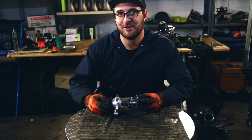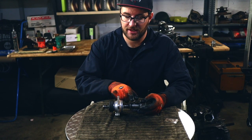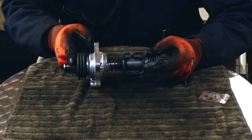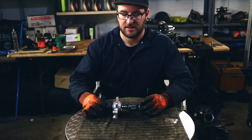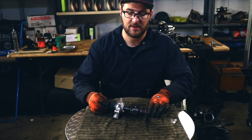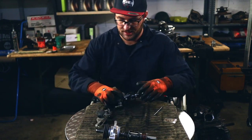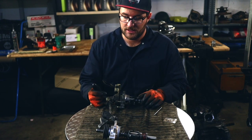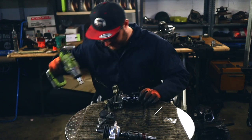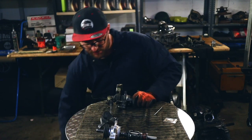If you want to avoid losing time, make sure that these teeth here are looking up like this — you see this dent has to be looking up on all of them. This is an important thing. Hit everything back in, put all parts in the same order, and this is the final result. Now what we need to do — this is the 1ZZ shifter linkage — we're going to be taking this part here and reusing it.